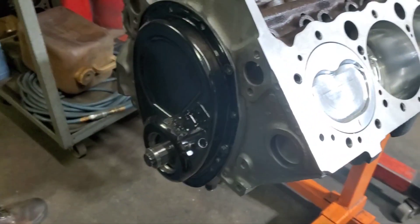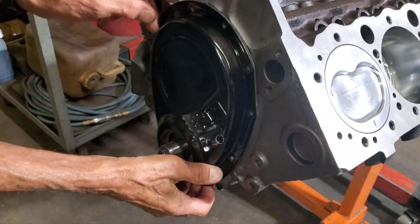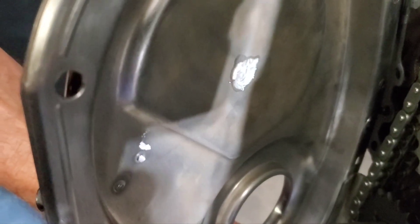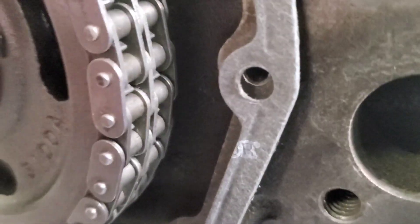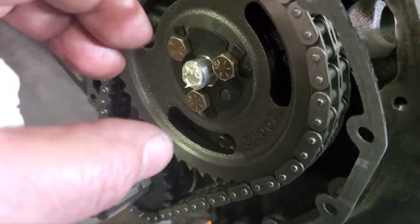It might help if you took all the bolts out — yeah, that's a good idea. That's what we like to see — it didn't we still have a slight film of grease on there. No metal-to-metal contact, so we're satisfied. You can see on our gasket we've already got an imprint of our timing cover — we've already compressed the gasket. It's awesome.